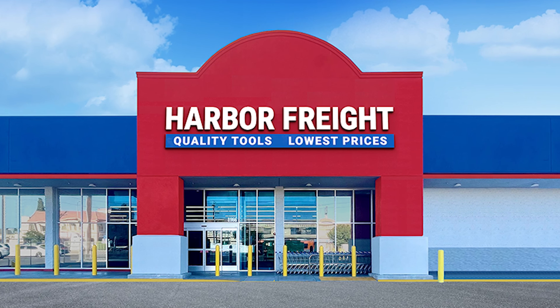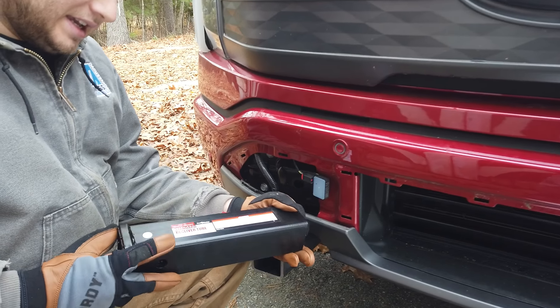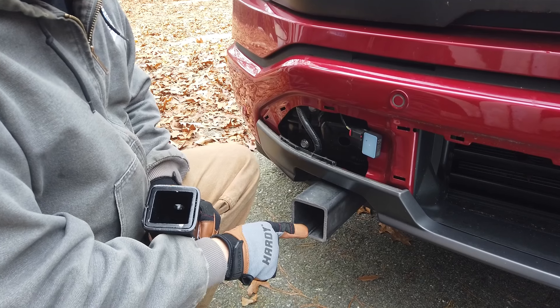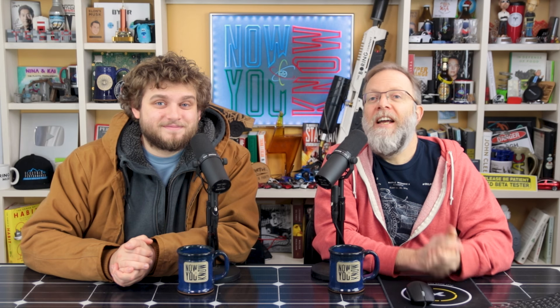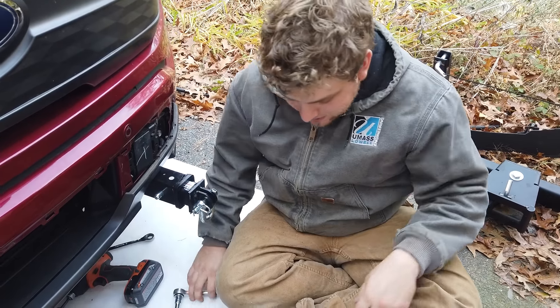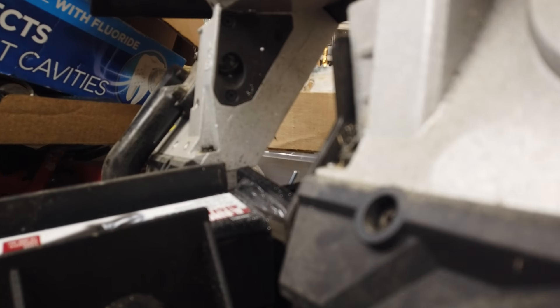We were about to weld these tusks onto another three-inch square steel bar across the front, but then Jesse got an idea. We had just been to Harbor Freight picking up a few items, and hitch stuff was on my mind. I thought, why don't we make the tusks out of actual two-inch hitch receivers, so that way we can attach and detach things anytime we want to the front of the truck. So we went back to Harbor Freight and picked up two hitch receivers, which were actually cheaper per foot than the three-inch square tube. We also got two two-inch hitch tow hooks that fit into the hitch receiver — we just wanted that male tube, so we cut off the hook parts.